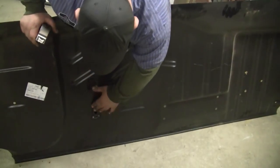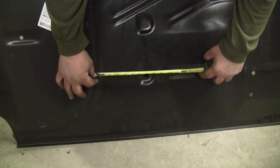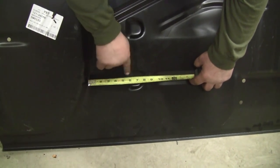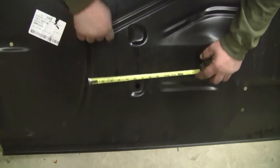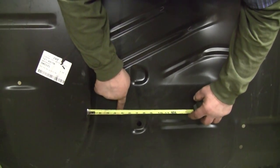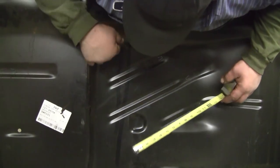We can cut our old panel out on the other side so we can temporarily mock it up and scribe where we need to cut out the old floor pan. Let's take a quick measurement of the new panel before we cut it. You can see our four mounting brace holes — this is where it goes into the support mount of the car and the actual body mount. It's a very strong structure point. Five inches is going to be about a good mark — you don't want to go too far close to the mount because that's going to weaken the metal even more. We'll stay between the two marks all the way to the end.